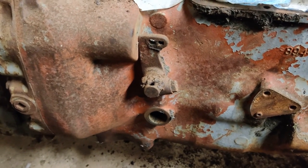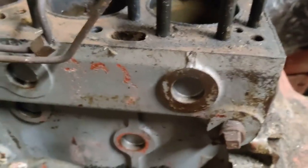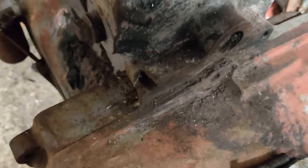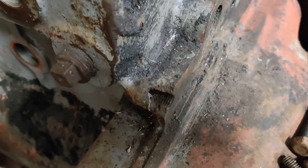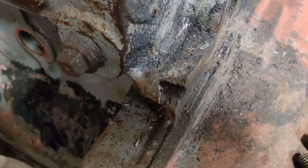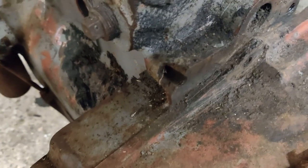There would have been an oil level in the clutch housing had the plate been present on the bottom, but unfortunately it wasn't. Rather than tighten up the bolts that hold the steering box on, they just had them so loose — and I imagine that happened when the driver hit something hard with the front right wheel. The steering box is so loose that it does that when it meets a shock. Still pondering how we're going to address that one.